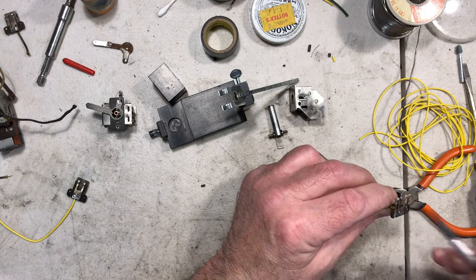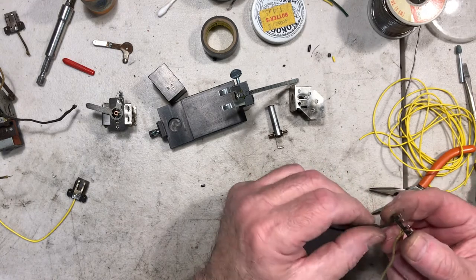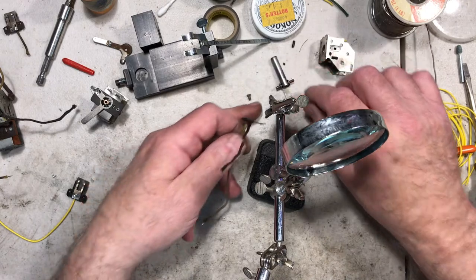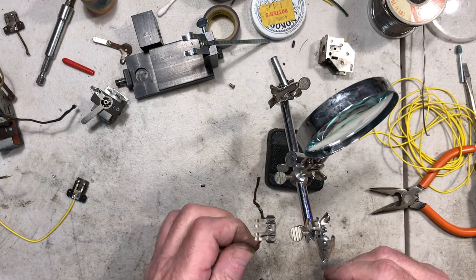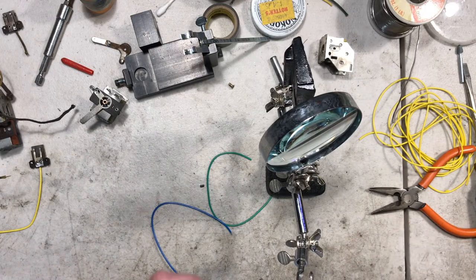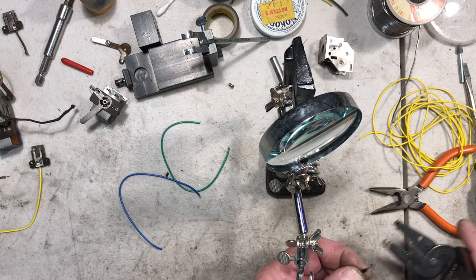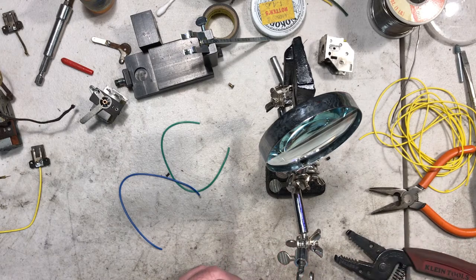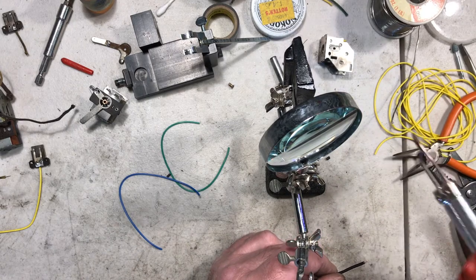As long as these are all touching the drum unit, we'll be in good shape. When you get them as evenly in the same position, they should line up. This one seems to be overly bent for some reason — I'll just real gently open that up a little bit. These don't look too bad. I'm going to take these wires off and replace them. I'm going to take these off and then when I get those off, I'll show you how we put on the different colored wires.